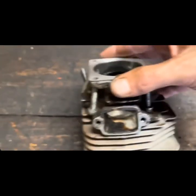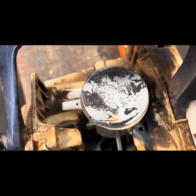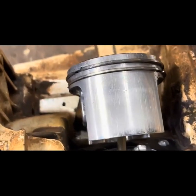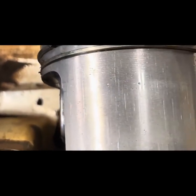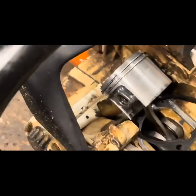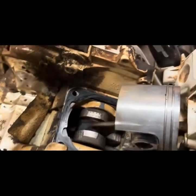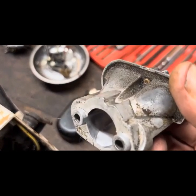You know, and this saw gets used a lot, and this is on a diet of 80 to 1. Okay. How about them apples? There's that. You can see those magnified and the light shining off of them. You can still see the machining rings on the piston. No telling how long ago this was rebuilt. We keep these in really good shape. I think some of those light scratches just might be from the particulate coming into the engine that the filter just won't grab. You follow me?